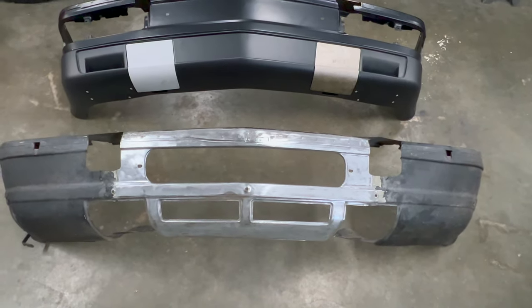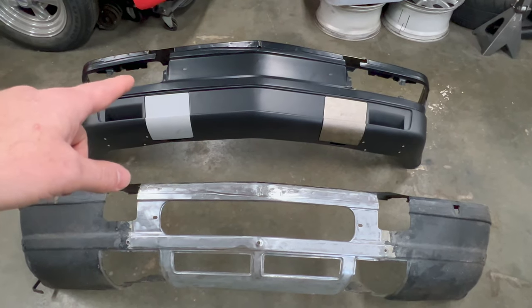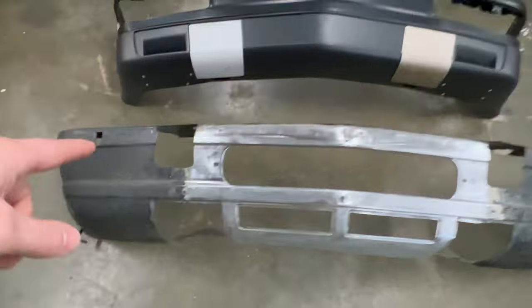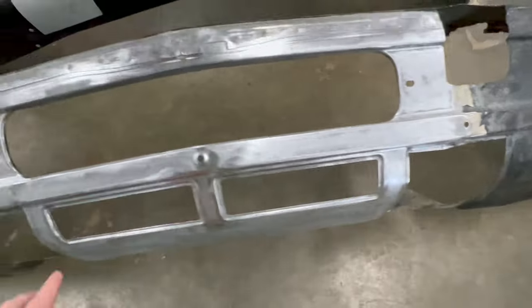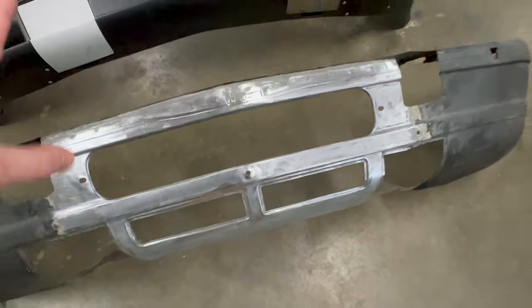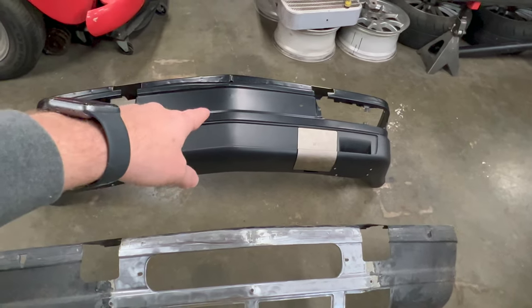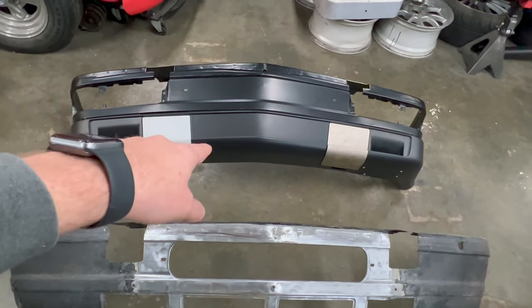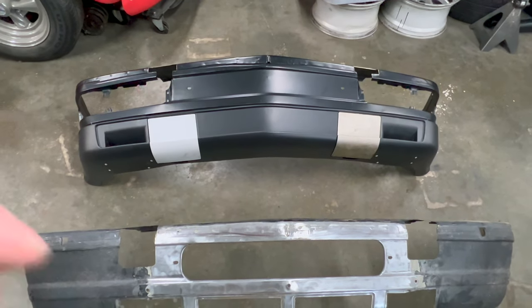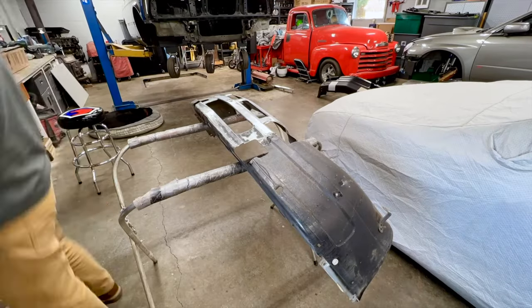I'm going to cut more than I need so that I can be smarter about where I make my cuts on the European valence and where the welds actually are. So I'll be more aggressive when I get over here, cut these off and drill the top, and then I'll start analyzing the fitment onto the US spec, excuse me, the European valence, but I'll need to get that front spoiler off before I get to that point. So I need to set the camera down and get this piece cut out.